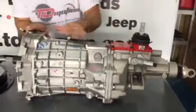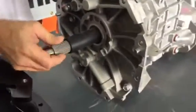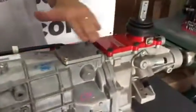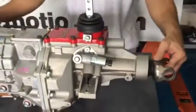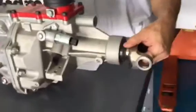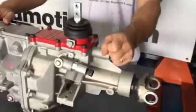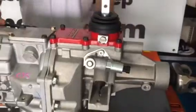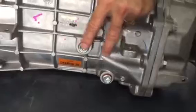If we work our way from the front and go to the back, it takes a 26 spline hardened input shaft. Towards the top we have the shifter locations — this takes multiple shift locations depending on your transmission tunnel. Then we have the 31 spline output shaft with a yoke in here right now. We also have locations for the mechanical and electric speedo cable and the speed sensor on the side of the transmission, as well as the fill and drain plugs right on the side of the trans.